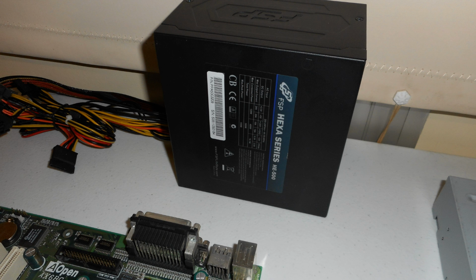With the power supply, I do recommend you get something modern and current. Old power supplies do have a tendency to have lower voltage tolerances, and that might be causing stability issues. And I know a lot of people where the power supply blew up and took some of the expensive retro hardware with them. So I do recommend get something new that works and you'll have fewer dramas.